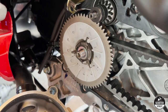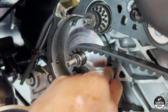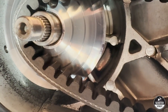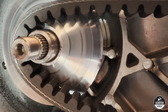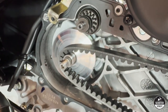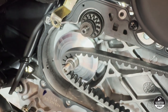Okay, back from the test ride. We'll quickly take the outer fan off and have a look at what the pen mark is telling us. That's a pretty good result - you can see the pen mark which was here, and now we've almost rubbed all of it off. That means the belt is getting to the outermost diameter of the pulley, which is exactly what we want. I just spoke to the customer who rode the bike: it was previously doing 52 kilometres an hour, and now we're doing 64 kilometres an hour - a great improvement.